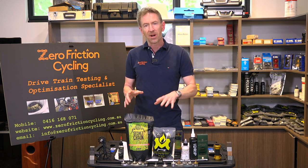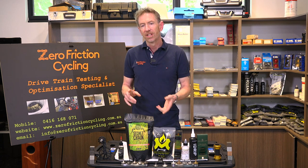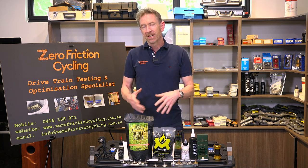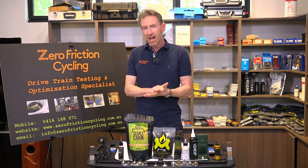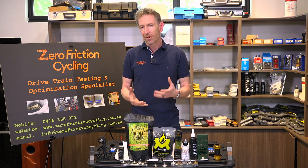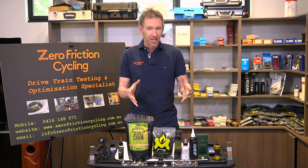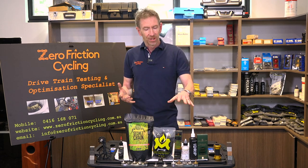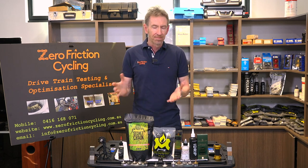There's one last type — wax emulsion lubes, which are kind of the generation before chain coating type lubricants. The top ones I'd list are Smoove and Squirt. They are a wax in a carrier, but when it evaporates off it's not a true solid or chain coating. They are very contamination resistant and high performing in themselves, but they do have some tricky sides — typically some initial penetration issues, meaning there's work involved in ensuring they penetrate properly. The latest generation chain coating lubes don't have that issue and can be a little more tricky on the maintenance side.